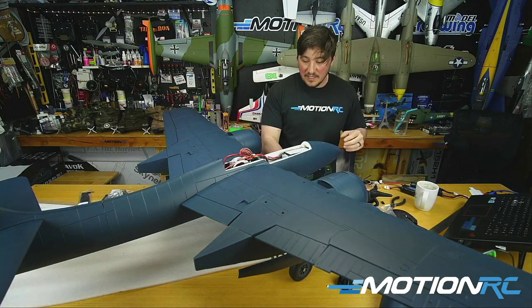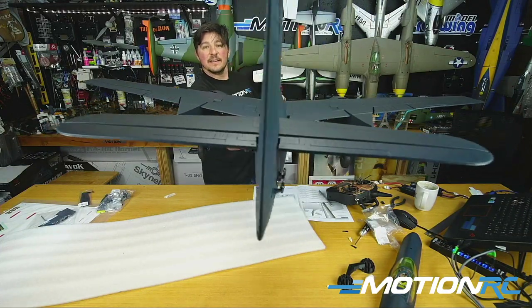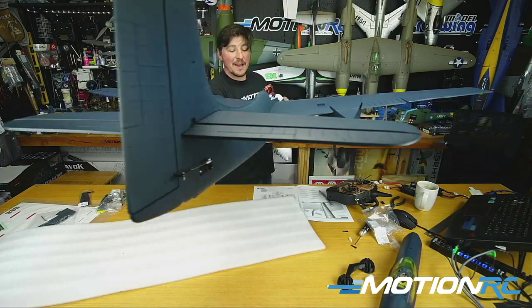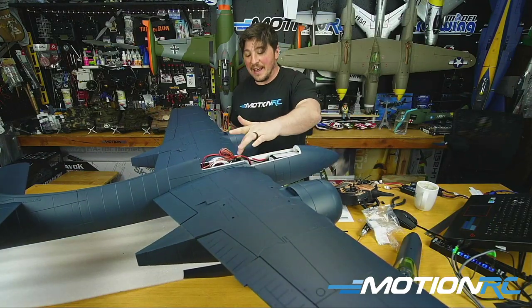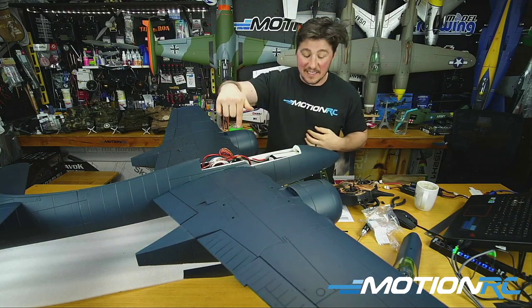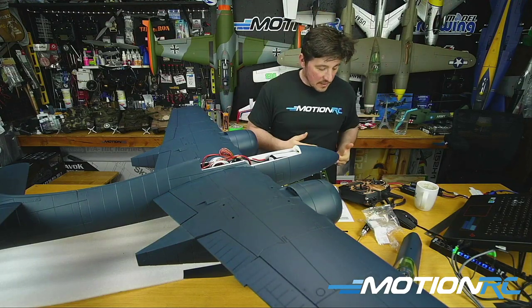So now, let's check, you go back and check it again. I'm gonna put the rudder right face. As it turns to me, the tail turns to me, the rudder is moving towards me. And that means it is all correcting in the right direction. So, now I'm gonna pretend that's where this gyro is gonna live. I'm not gonna try to, because you want access to it. Now I know my directions are good. Now it's all about how much gain you want on your gyro.